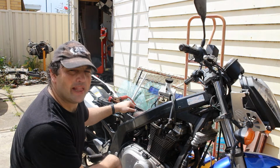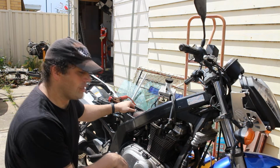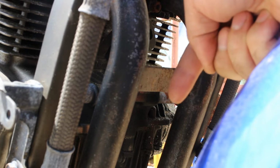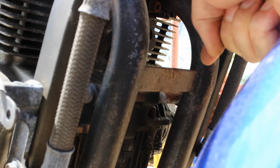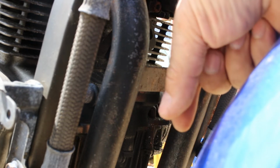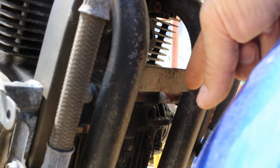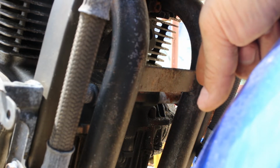First up, we're looking at the exhaust and what I actually did to it. So, come down here. Normally in here there's a piece of tube that goes between the two. Now, it's a balance pipe, but this is a 2-in-1 exhaust, so it doesn't really need to be balanced. They actually put these in to reduce a bit of the noise.